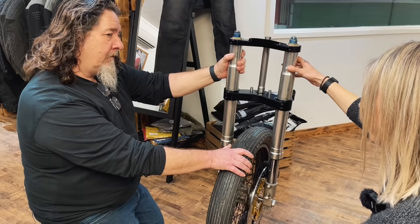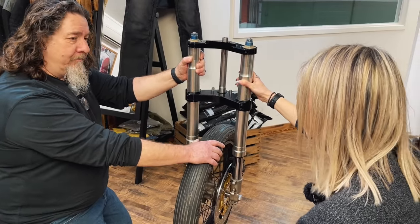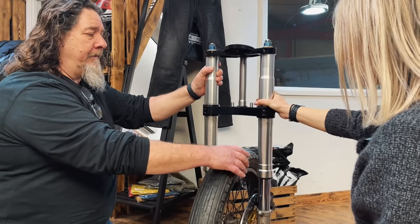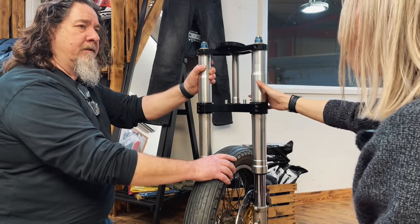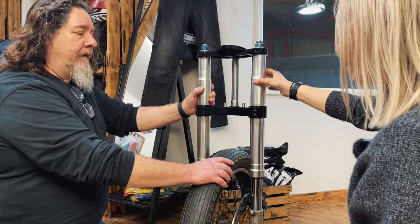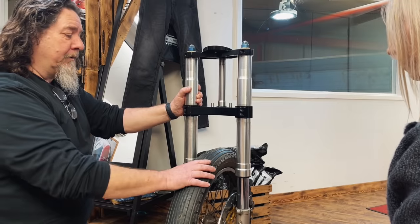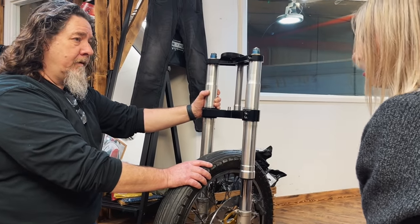But will it tear down, or not? It might mark with stone chips and stuff. Oh, so it can be painted. Yeah. If it's powder coated again, it would need stripping. And with powder coat, you need to watch out with the sizes, because obviously we've machined these to a size. Oh, okay. So it has to be something with a very, very thin layer. Yeah, anodized or Cerakote. That's the best option for that. You have more colour choice with Cerakote as well. I only need black.